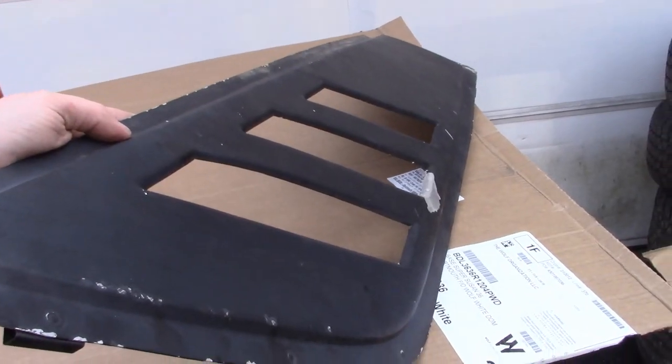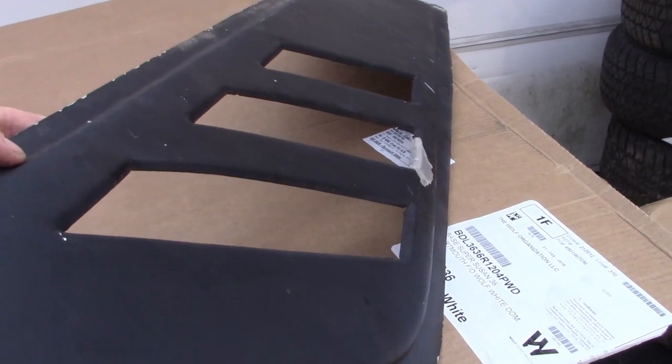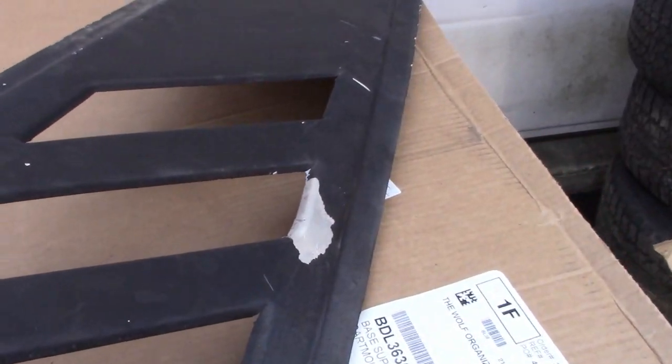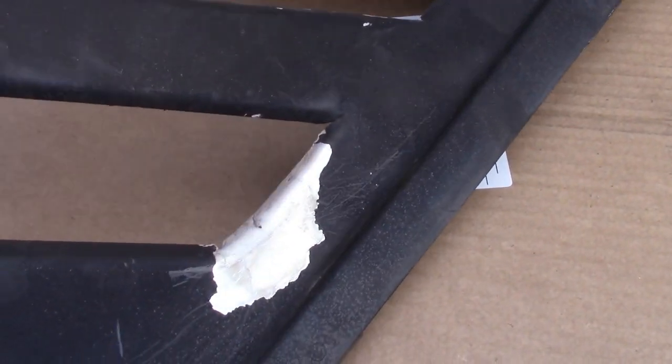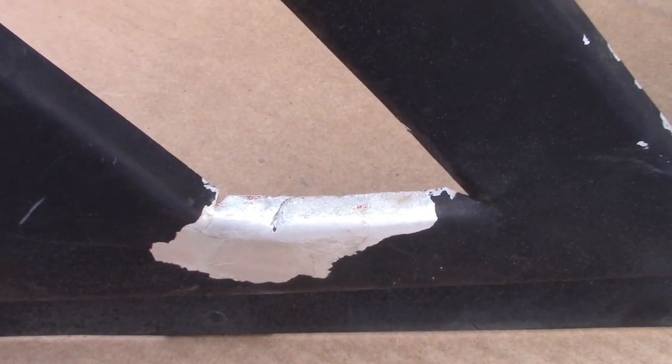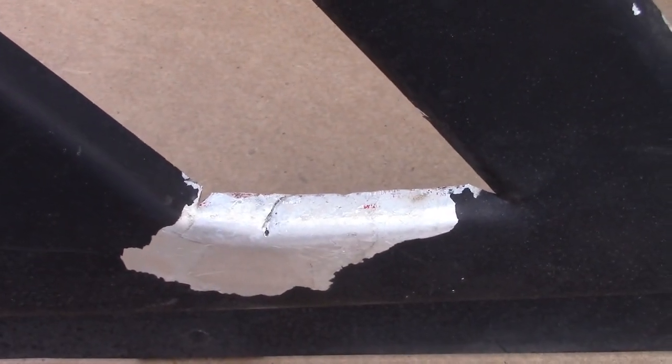Oh, alright. We'll be right back. I am just all over the place multitasking jobs today and yesterday and the day before. But I pounded the best of this dent out that I could with a hammer and dolly set. I think it came out alright. I even put the little lip on it in the end.